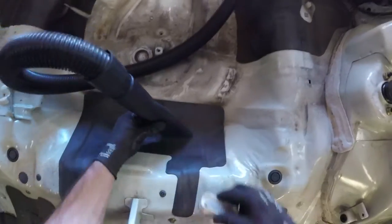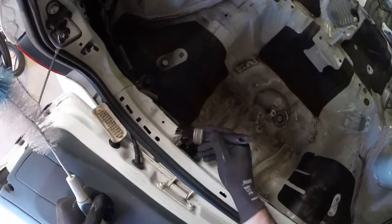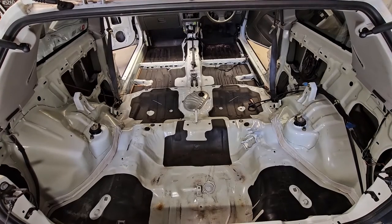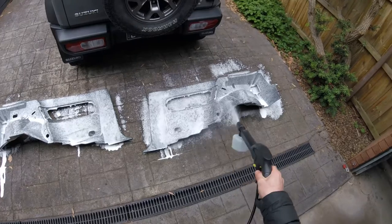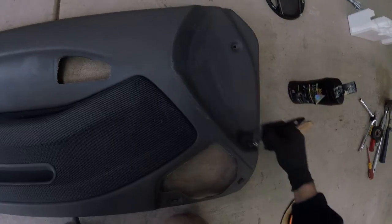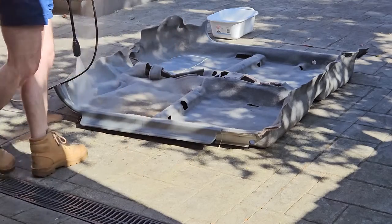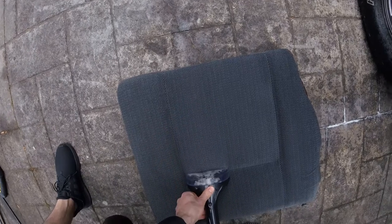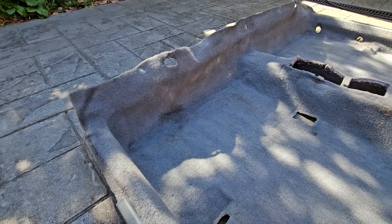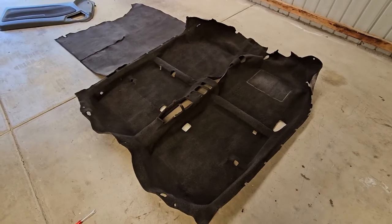The process is simple. I'll use a brush to disturb the grime, I'll vacuum what I can, then I'll use a brush and soapy water to disturb it again, before lastly drying it with a rag. For trim pieces, the only difference is a high pressure hose, then applying some very generous coat of Meguiar's Ultimate Protection Dash and Trim Restorer, which costs like $30. For parts such as carpets, either a high pressure hose or extraction vacuum, or both. Cleaning the carpet wasn't very effective, so applying four coats of RIT carpet dye that I got for $30, and I got myself some new carpet when it dried.